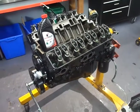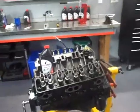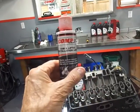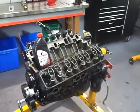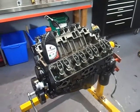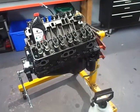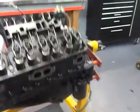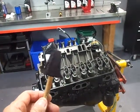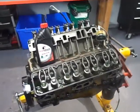While the lifters were out I needed to get some lube onto that camshaft. When I took the lifters out there was no break-in lube on them, so I'm using Comp Cams cam and lifter installation lube — that's one of the important steps for breaking in a new cam. If I had installed this cam myself I would have sprayed it with graphite lubricant before it went in, but it's already in there; that step is optional but everything helps. To get the cam lubed with the lifters out, I used this little brush, dipped it in the cam installation lube, put it down each lifter hole, and turned the engine over as I did that, which got the cam lubricated.